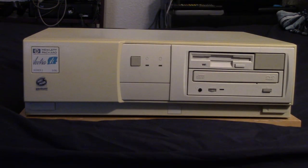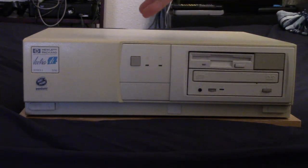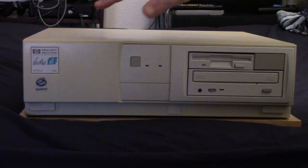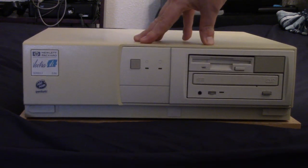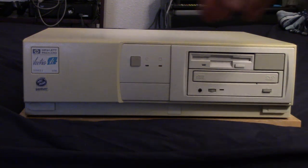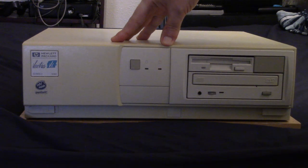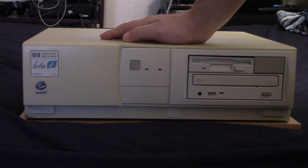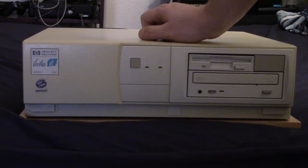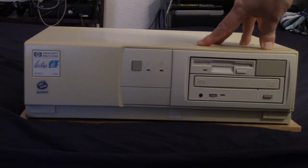Downsides of the audio card, the Ensoniq Soundscapes in general: once you get the drivers installed, they work fine. If you've got Windows 3.1 or 95 on your machine, installation doesn't seem to be a problem at all, and it automatically sets things up for DOS. But if you're putting them in a pure DOS machine, you've got to do a little bit of trickery with the install, since apparently they really weren't meant for pure DOS machines. Another thing to keep in mind with the Soundscapes is they really were meant for later DOS games and earlier Windows games. There's no OPL true FM chip on there, which kind of sucks, but the general MIDI, in my opinion, sounds pretty good.